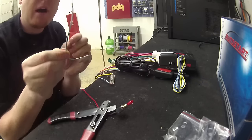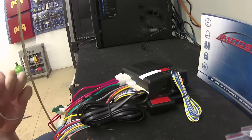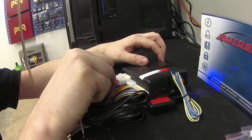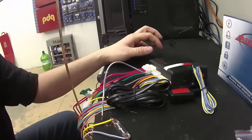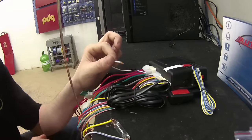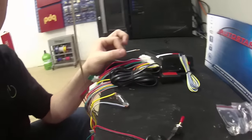I'm going to take this little pigtail wire and move the camera over so you can get a better view. I'm going to take this end and stick it in the black wire — black wire is always ground. Be careful here so that you don't short this out with any other inputs. Make sure the car is off when you're doing this. You're going to take the other end and probe it into the gray wire. When I do that, the light bulb is going to illuminate.